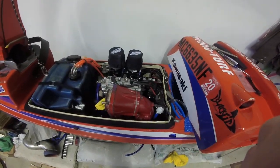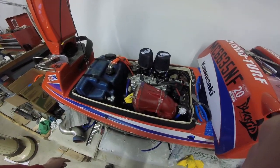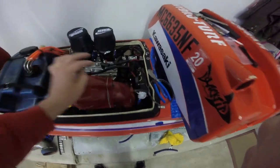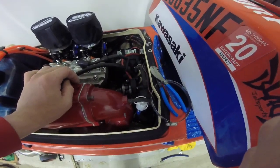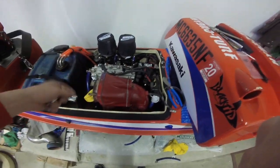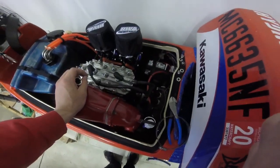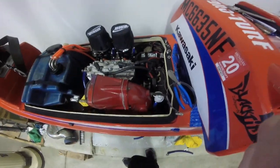I've just been picking up other parts that I want for this, and I've also got another jet ski in the works right now that I'll be going over in the future. So just make sure you get some shims, bolts in loose, and then align away — slide it back and forth, add shims to each side. It took me five hours of messing with it to get it to good alignment, so just take your time, make sure that it's done right, and hopefully you won't have to pull it apart again.